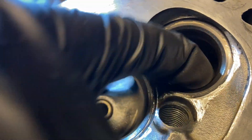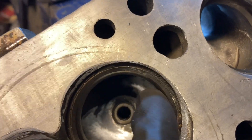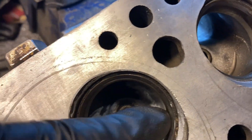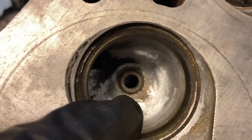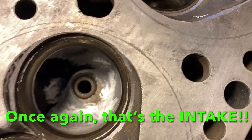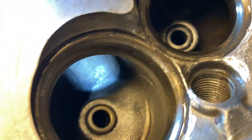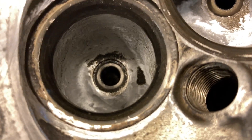Any sharp edges are not good for flow. On the head next to it I've already started on the intake side — most of that ridge is taken out. It's not polished yet, just rough work, but you can see the rounded edges coming into the throat around the valve. I'm doing each port to a certain point, then flipping the head over to work from the exhaust side, and continuing with the exhaust ports as well.